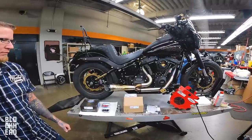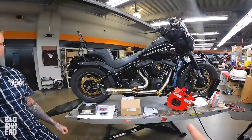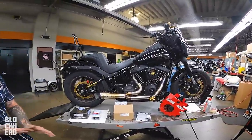Also, for those of you out there that really appreciate the tech, you were asking if Chris measured the runout in a previous video. So he told me to get here early today because we can't do this on a warm engine. As an engine warms, it grows. Clearances shrink, if that makes sense. So we'll measure runout for you guys just so you can see the process, and know where his engine's at right now. We talked about those clearances, and he said we've got to cool down the engine before we start working on it.